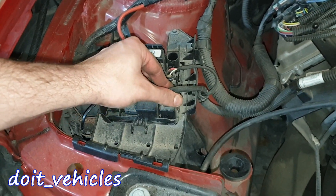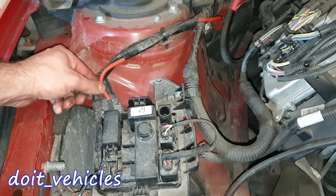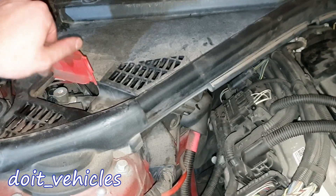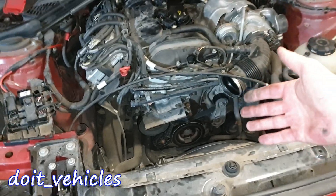Here on the passenger side we've got a control panel. This connector is for the injectors because this car is direct injected. This connector is for the vent valve for the fuel tank. The positive side 12 volt delivery line comes from the power distributor which is in the trunk. Under this cover we've got a fuse box. Here we've got the positive side of the car battery and here the negative side. Here we also have the windshield washer fluid.